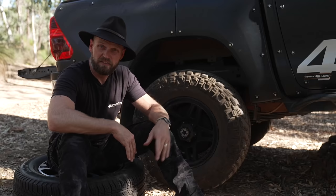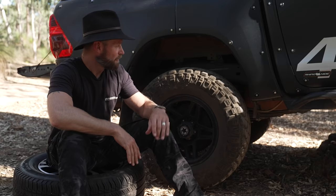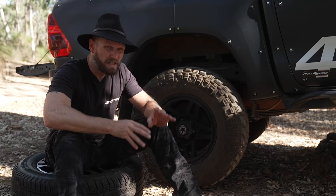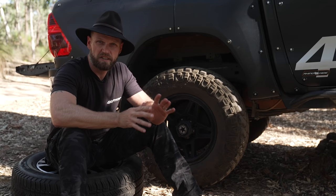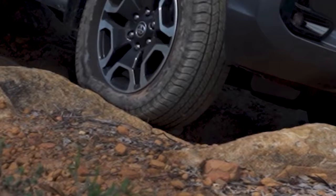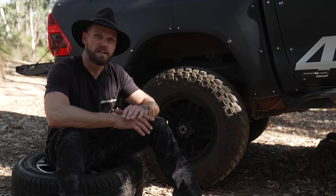Remember the 120 vs 120. The whole reason for that exercise is to really emphasise the fact that once we start lowering these tyres to get more grip and traction when we go off road — especially in sand — we want to gain more footprint. The less sidewall we have, the less footprint we're going to be able to achieve. And not only that: when we're hopping around on rocky stuff or hit a log or a washout really fast, that tyre has got less compression before it hits the rim itself. That's how you can damage your rim, your tyres, your vehicle and your suspension.